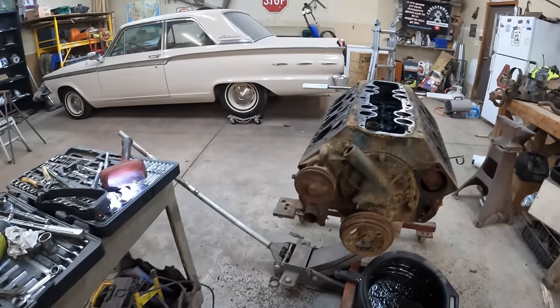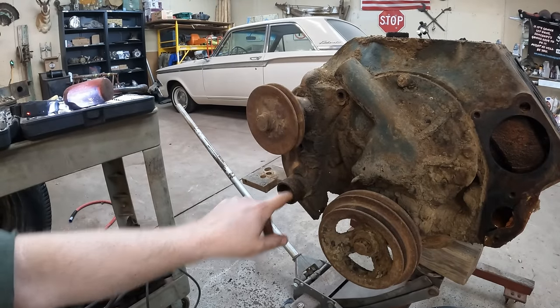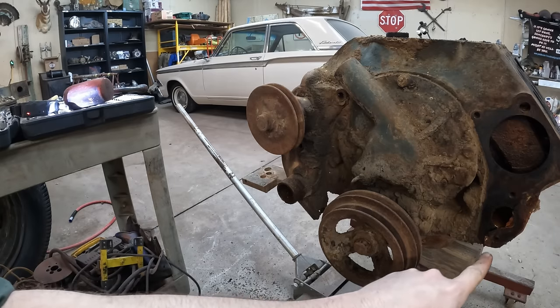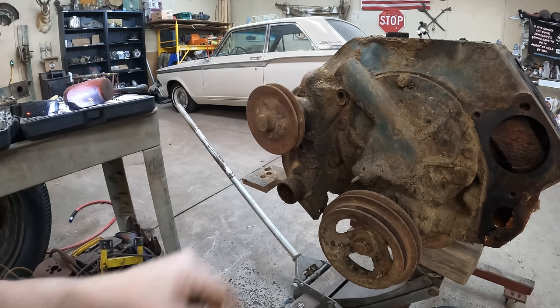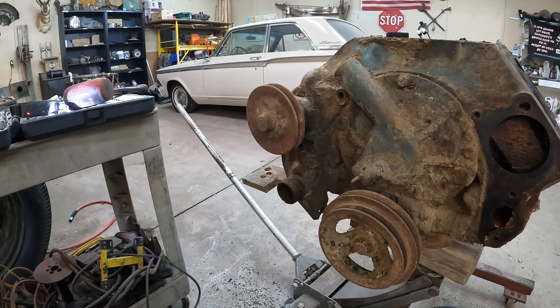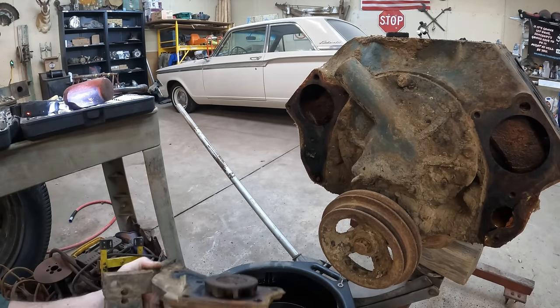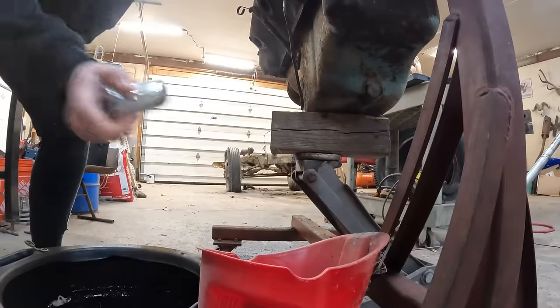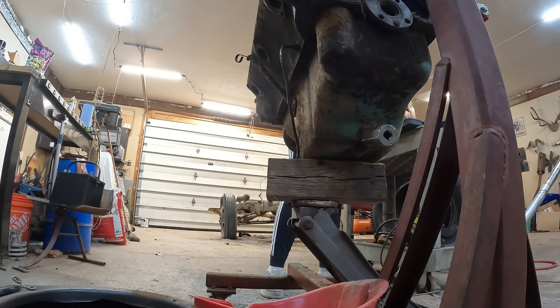Okay, we had one bolt that wasn't actually tight, even though it was inside of the water jacket. Each of these water pumps has one internal bolt. I think it had been rounded off before, because as soon as we put a socket on it, it started spinning on top of the head. So I just had to downsize, force a half inch over top of it, the next size down, and run it out by hand instead of using the gun. So that's the second water pump. Am I opening this? Yep. There you go. Eyeballing it with the old inch and an eighth.